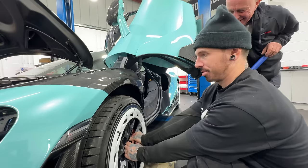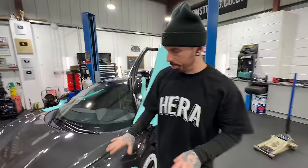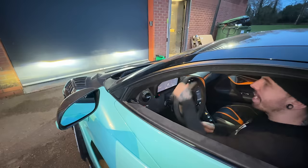I'm well excited to drive this car. We still haven't decided on a road trip — this could be the Monaco car! Both headlights are in. We're going to make sure they are flat before we put all the arch liners in — perfectly straight beam. And look — left and right, they have got the kick. That should pass an MOT.